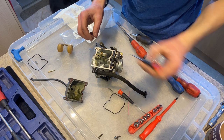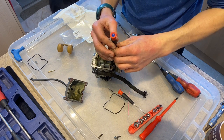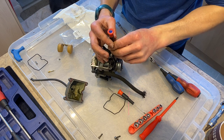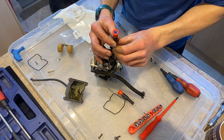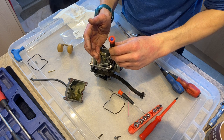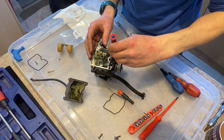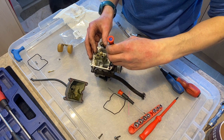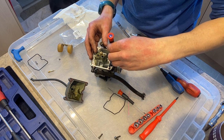I'm going to wind it all the way back down to fully seated. Obviously, just being cautious with it first going back in so that everything sits in where it should be. So find where the bottom is, and then bring it back two turns. Going for the standard two then, rather than the 3 1/4 that we found it. Okay.